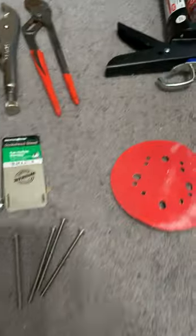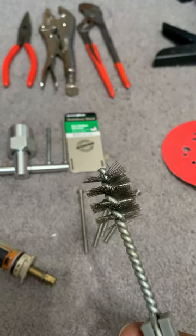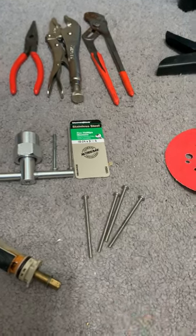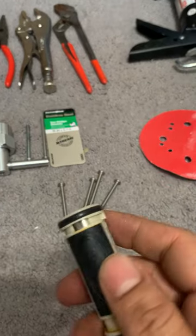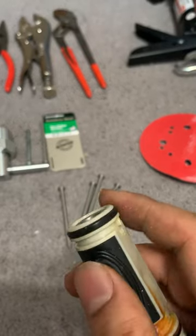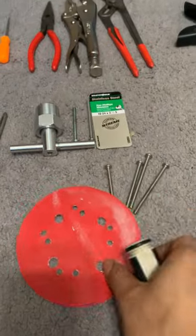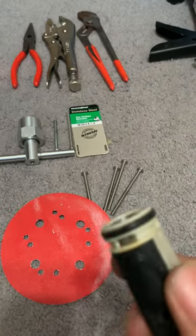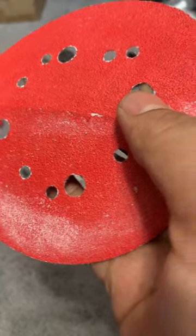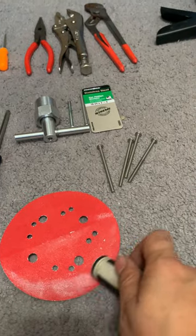To solve it, I kept brushing the inside and cleaning it out. I ran my finger inside the valve to check that nothing was sticking. Other videos mentioned that for the new cartridge, the bottom piece is slightly bigger, and that was causing the cartridge to not go in all the way. So I took 80-grit sandpaper and started rubbing it on the new cartridge. You can see the slight amount of material that got removed from the cartridge all around. I would place it and keep rubbing with a little bit of force.